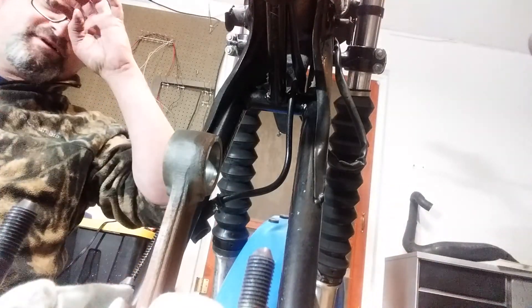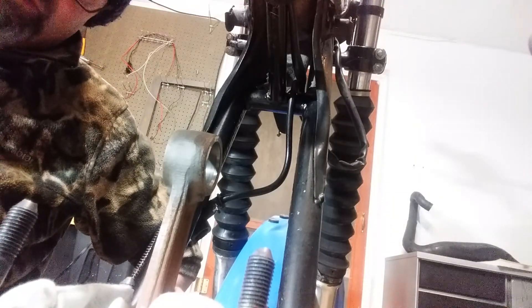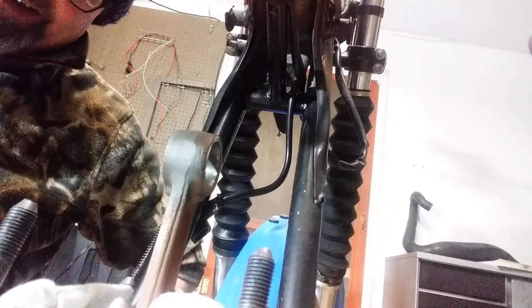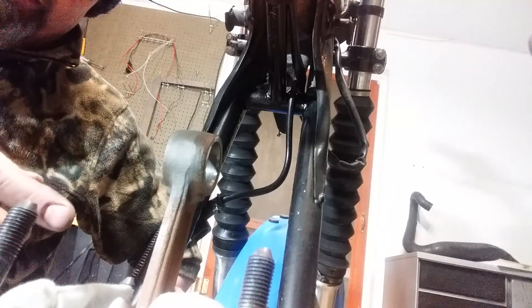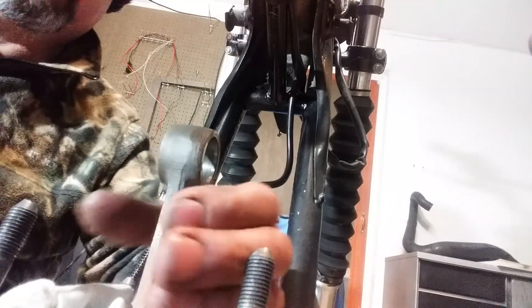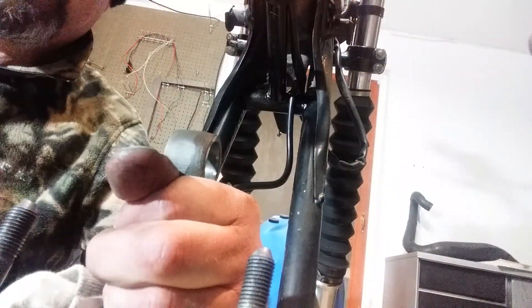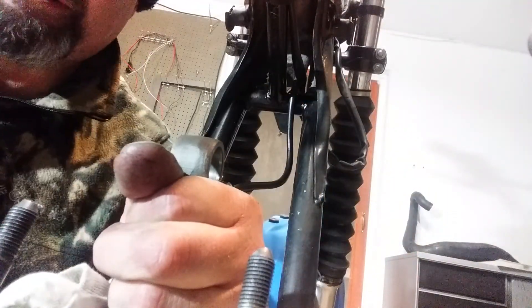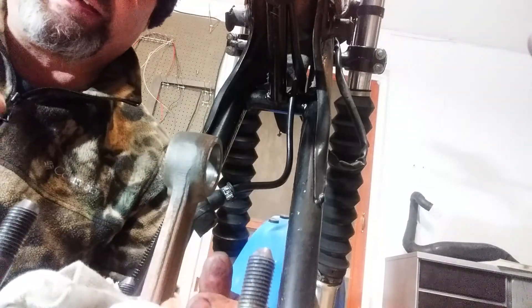As part two, my axial wear in my crank was well within specs — it was 0.075, and it's allowed to go to 0.2. The old-fashioned way to check your lower end bearing is to grab the conrod, pull it up tight, and then hit it really hard and see if you hear a metallic tap. There is no metallic tap.